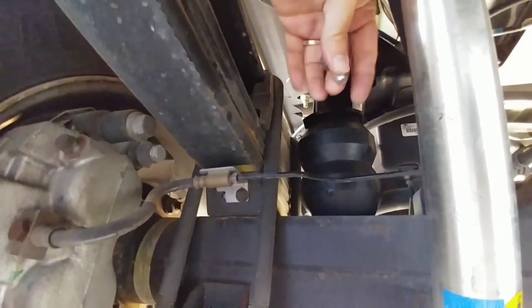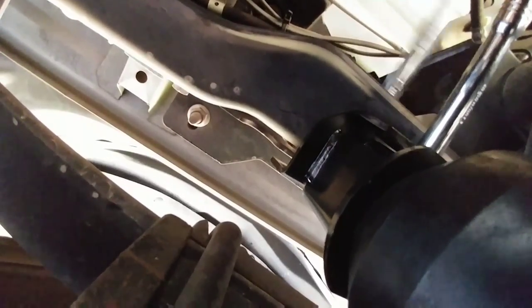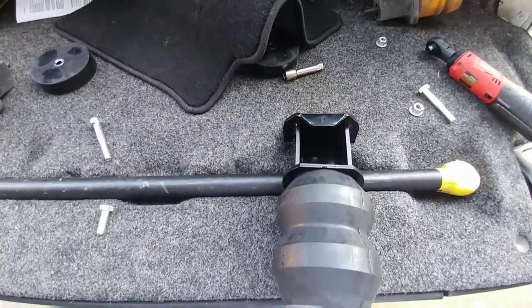Next, I'm going to take the bolt and washer, feed it up through the bottom back here through the hole, and secure the nut on top so I can tighten it down with my wrench. As you can see, I've fed the bolt up through this hole here and the nut's on top ready to tighten down. Here's with the Timbren installed, attached, and sitting above the axle. There's a little bit more than an inch of clearance between it and the top of the axle, and plenty of clearance away from the brake line. Now I'm going to repeat that process on the other side.